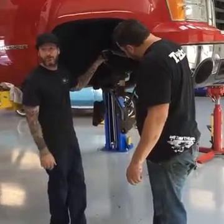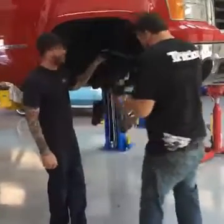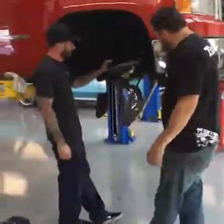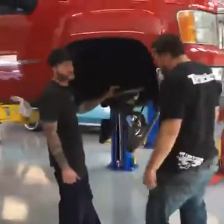Oh, okay. So for anybody who's got hard parts, there's a replacement at your auto parts store. So upper, it'd just be a matter of unbolting and bolting it back in. The lower you'd have to press in, which is no different from a factory control arm. Right.